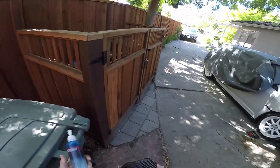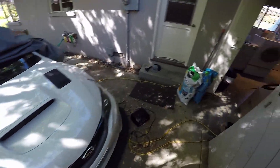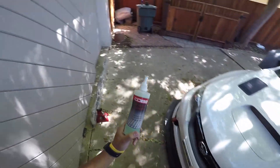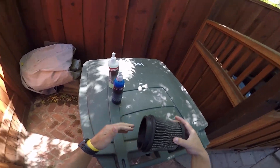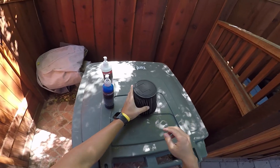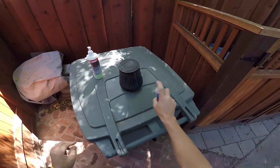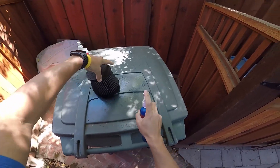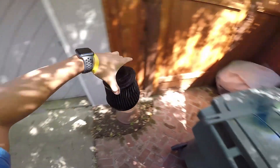If you guys have never done this before — it comes with two cleaners. There's a green cleaner here. If you own a Subaru with a Cobb intake, you should have cleaned your intake at least once. You take the intake off, smack off the dirt, spray the cleaner on, let it air dry for about 15 minutes, then rinse from the inside out, let it dry all the way overnight, apply the oil liberally but not soaking it, and let that dry.